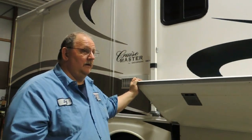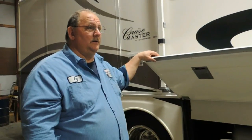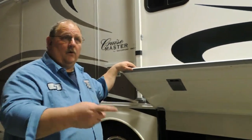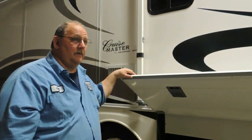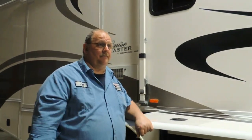If you're going to use it in winter, you've got to plan on keeping the full unit heated with the furnace until you're ready to dump it, or until the weather warms up. Heating means using the coach furnace, because electric cube heaters don't heat the basement. If you've got black water in your toilet and things freeze up, you can create a lot of damage.